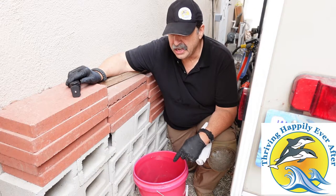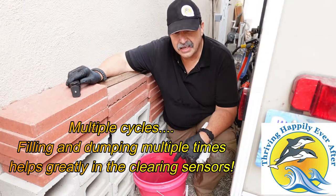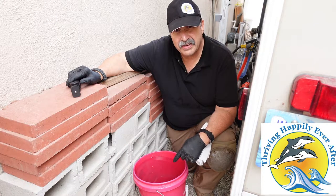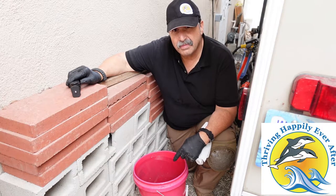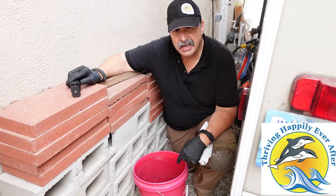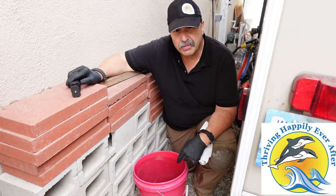What you want to do is kind of do this repeatedly — just doing it once isn't really how I do it. Before I go back and check the gauges, what I've been doing is doing cycles — sometimes three or four, and sometimes five cycles, depending on how I feel about it and what kind of time I have. We know that 45 seconds fills five gallons of water. Running a minute and a half means 10 gallons back into the black tank, which holds 33 gallons — so we're only about a third full at that point when I'm dumping and flushing again.